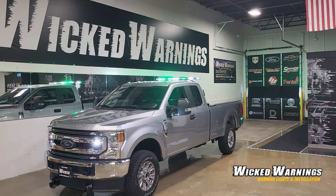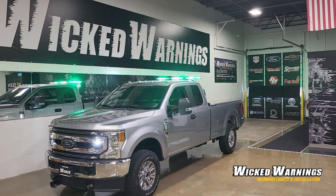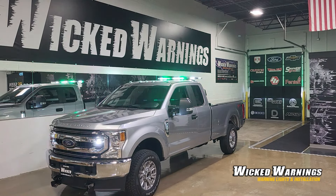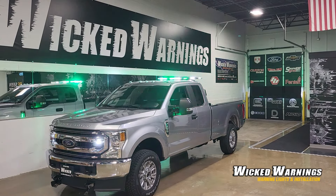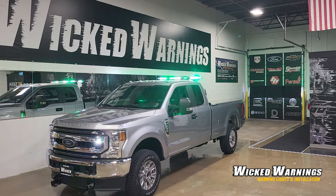Here's a little bit of side view for you. We were asked to keep that light bar as snug to the roof line as possible because this truck does go in and out of several parking garages. So what we did is we ordered a back rack, trimmed it, and kept that light bar basically right above the roof. That's about as low as possible to mount a light bar on one of these trucks, and it'll allow them to get in and out of all the parking garages without damage to the light bar while casting the warning all around as needed.